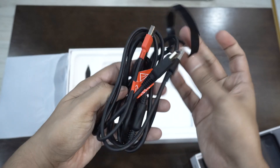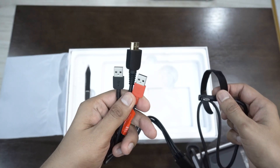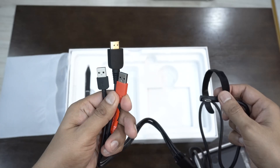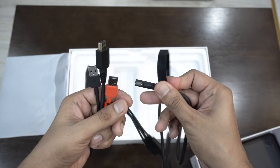You also get two wires in the box — one is a USB-C to HDMI with two standard USB ports, and also a USB extendable cable. The inclusion of an extendable cable is smart; if your power outlet and the CPU or laptop are far off, this cable helps. The HDMI port is for the display signal, the USB port is for the PC to recognize the device, and the third red USB is there in case the earlier two ports fail to give enough power to the tablet.